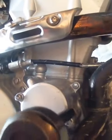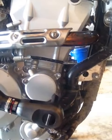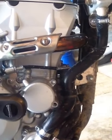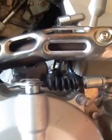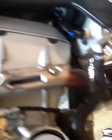And then I'm going to pull the oil filter off, which is two 8mm bolts right here. I just got to pull this little cap off, and that's your oil filter right in there.